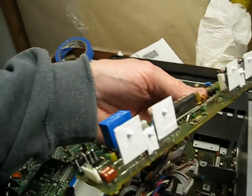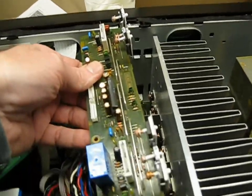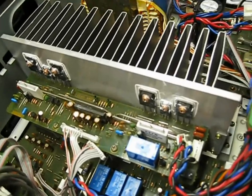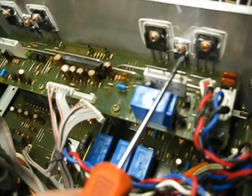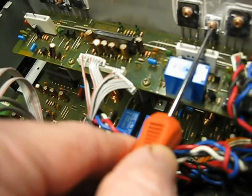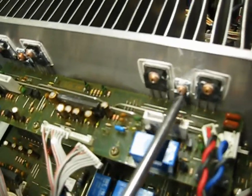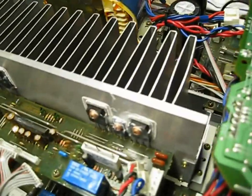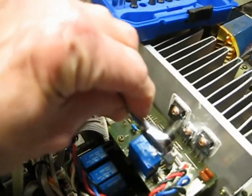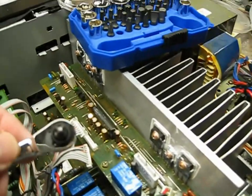I have thermal compound where needed, threaded my screws through, and now trying to get it into place without making a big mess. It's in place. If you're working on one of these, you're going to want to use a small screwdriver — these two screws are a bugger to get to, especially this one with the relay in the way. Use a smaller screwdriver to get it all the way down, then use your regular size screwdriver to do the final snug up. If you have one of these tool sets it makes it a lot quicker. Just don't over-tighten those screws — they have a lock washer; get them real snug but don't go splitting anything.